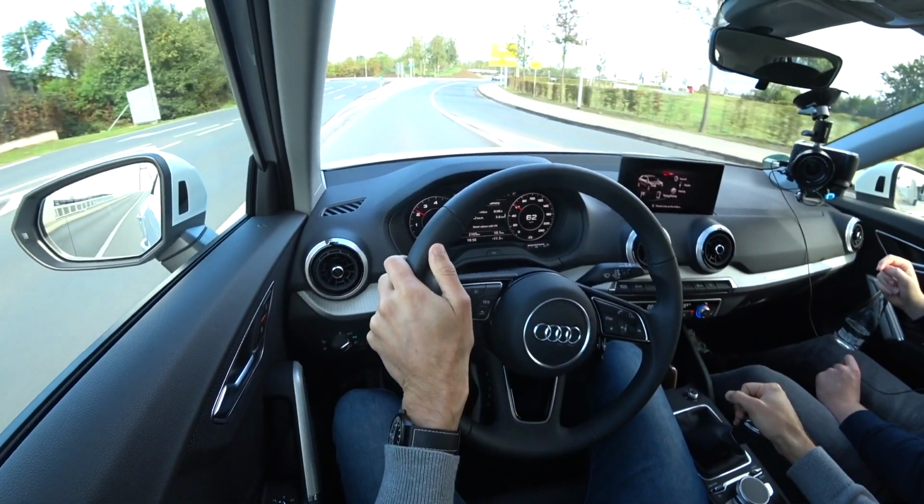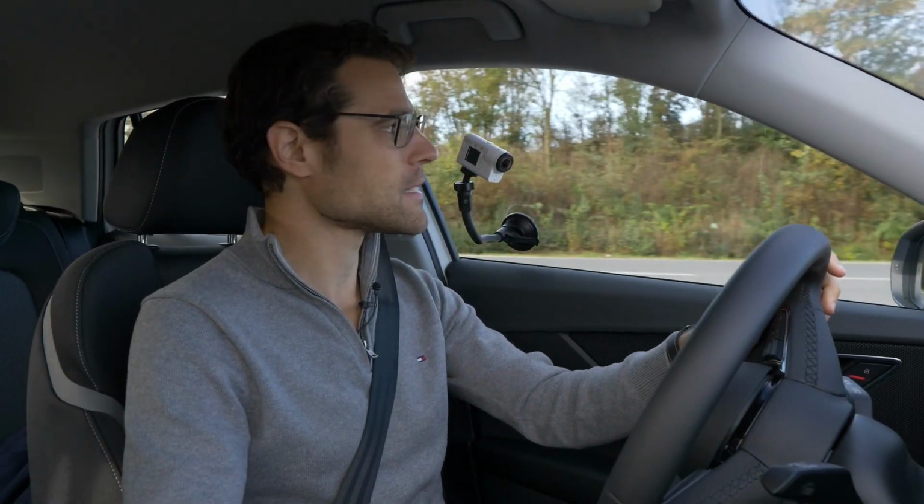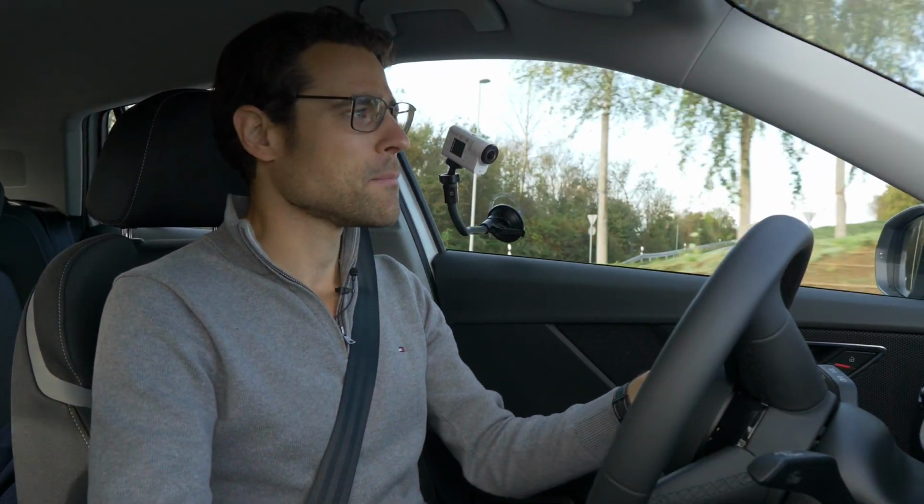For the long-term durability, that might be a better choice than when you have an engine with a little bit higher displacement but you keep it at lower RPMs, then it's actually a little bit more suitable than keeping with the low displacement and keeping it at high RPMs. It's just more stress on the engine.